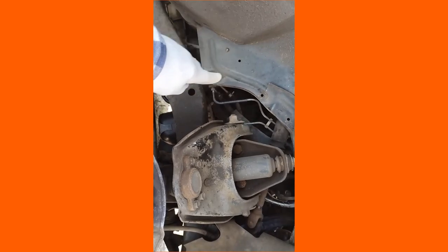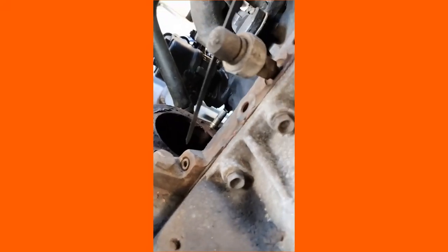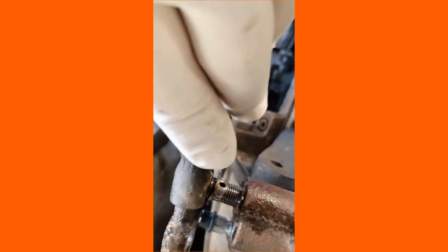The installation is fairly easy — I just dropped it straight down. I did remove the clutch hydraulic line, the rubber bit, and I was able to get the old one out through this area here. There's the hydraulic line, there's the starter motor housing — it just came directly down once the hydraulic line was out. That gap is sufficient to get the starter motor out.